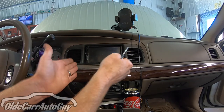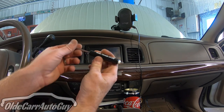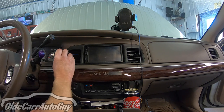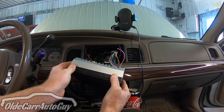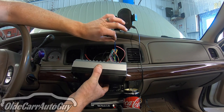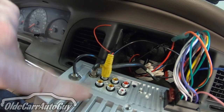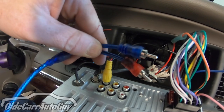This head unit is pressure-fit inside the cavity — when I installed it, it was a tight fit so I did some trimming. We're going to use a little mini pry bar tool and just reach in and give it a slide out on each side. Inside is the rat's nest of wiring, and that's where we find the blue power control wire. On the back of the stereo we're looking for audio out — those first two plug-ins match up to our signal wire, which we'll run back to the amp. First we've got to snake it up through the dash into the cavity to plug it in.